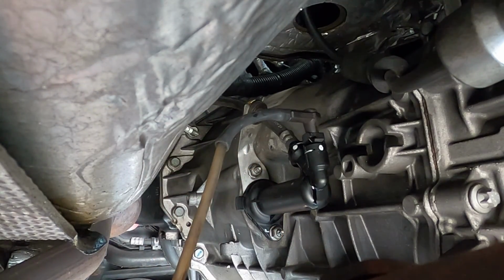It's really important, you wanna make sure you don't run the reservoir dry. It's very easy to do with one of these vacuum systems. So if you can have some sort of system to pre-fill the master cylinder reservoir as it drains out, that would be ideal.